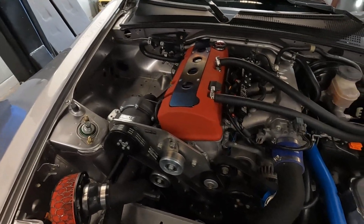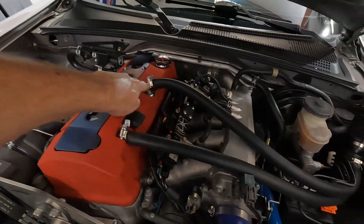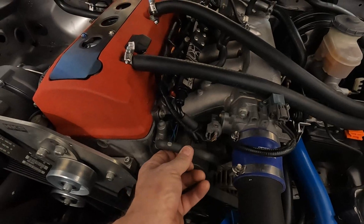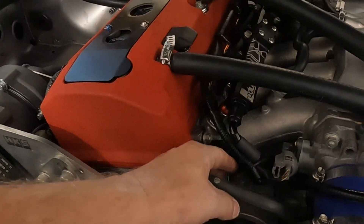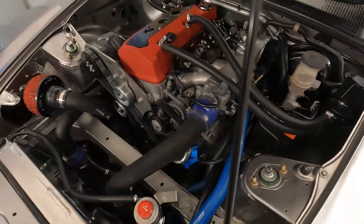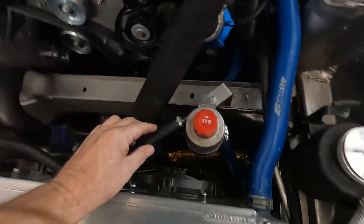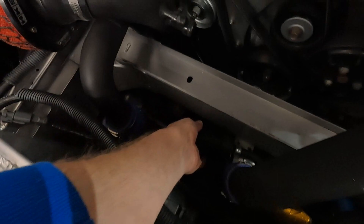For right now, a few things we're looking at. This is the PCV hose — it goes from here to here. You can see it has lines in it but it's not designed to carry water under pressure; it doesn't have any fibers to stop it ballooning, so we definitely recommend replacing that. These wires here really need some loom — they're tucked behind here, not secured, and not protected. This is just jammed over here — it's awful. These are water hoses not designed for oil, and they don't look right either. We're going to change these to AN fittings and relocate them. This component is only in one bracket and will eventually break from flexing, so it really needs a proper bracket.